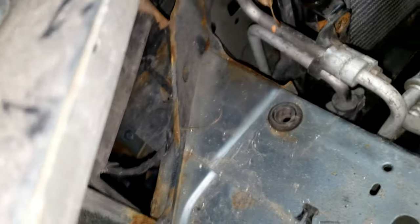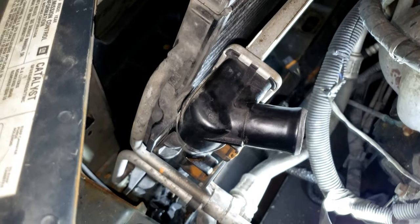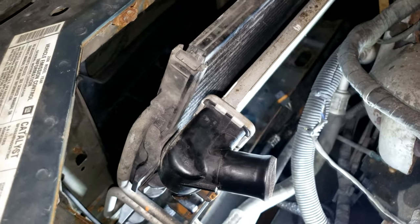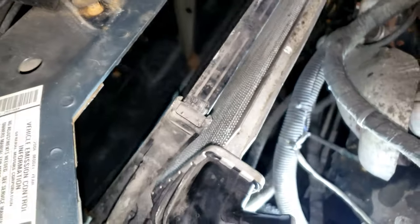Something I found out that I hadn't really seen in any other how-to videos — I'm assuming this is the AC condenser, and yes, that's what it is. Right back here you can't see it, but there's a clip right here you've got to pull out. You push the radiator down and the condenser up to unlock it — there are two on each side.